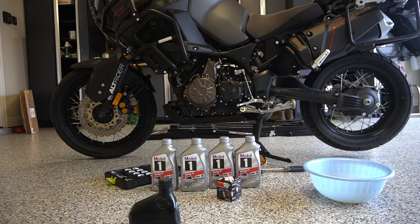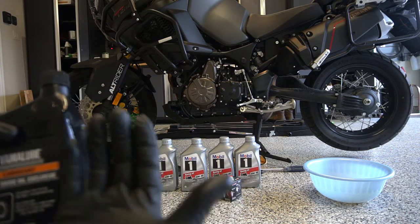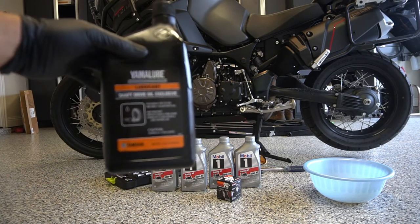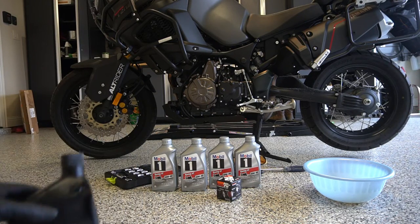So, you know, there's a lot of people out there running Valvoline. I see some people running Amsoil. I particularly couldn't find Valvoline in my local stores that had no additives in it. All of them had a limited slip additive, and that's a big no-no. I don't want that in there. So I just stuck with the original Yamalube. And so you only need 0.2 quarts, so you only need a little bit of this stuff to fill up that final shaft drive. So I have much more than needed. Like I said, I got this at a discount, but be careful.